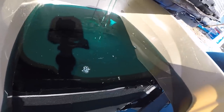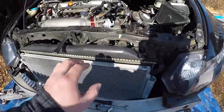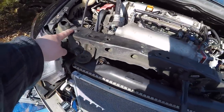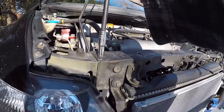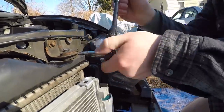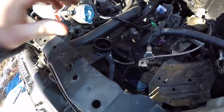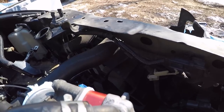This coolant literally looks brand new and it's been like 30,000 to 40,000 miles since I changed it last. While we're waiting for that to drain, we're going to go ahead and remove the bulkhead cover — this whole assembly right here. We have all 10 millimeter bolts. There's a few on the top — two right there, one right here, and then there's ones in the back. We can take these two off on top for the coolant filler neck, 10 millimeters. We're going to tuck the coolant neck under the bulkhead and then lift right up. Undo this sensor right here for the fans and everything, then we can take the bulkhead off.